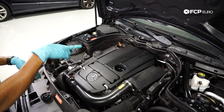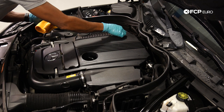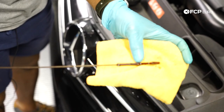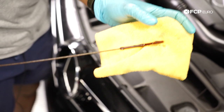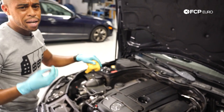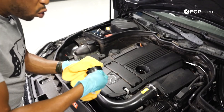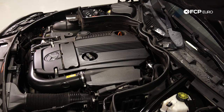Once that's done, we'll reset the service indicator. We gave the vehicle time for the oil to drain back into the oil pan — we're just going to check the dipstick now. On this dipstick, this is your min line, this is your max. The actual dot is what we're looking for as our reference point. It's a little bit below that, so I'm going to add about the remaining half liter of fluid. If you're ever uncertain of how much fluid you need to get from min to max, just consult the owner's manual, or add in quarter-liter increments at a time. I'm just wiping down the cap gasket and closing that up.